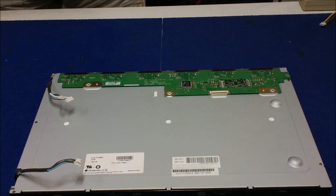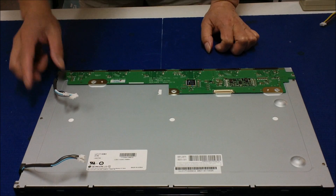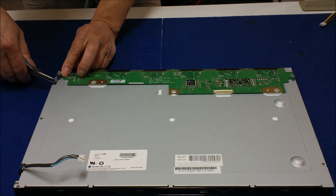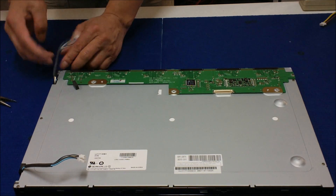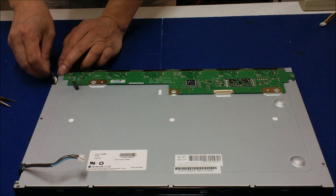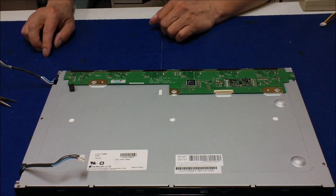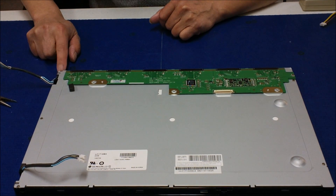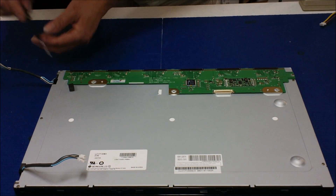Set aside the metal frame. There are two tiny screws — first, you have to move this foam out, just pull it out. That fills this plastic block. Take this wire out. And there you see there's a small screw that's holding the reflectors. So basically, you just unscrew it.